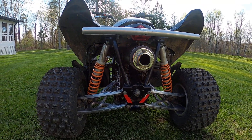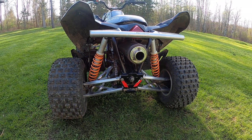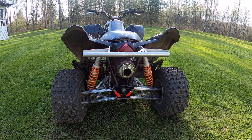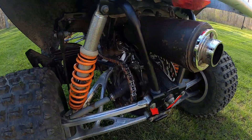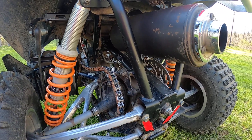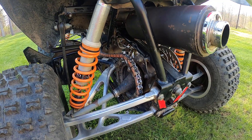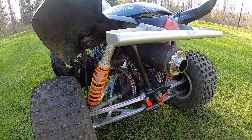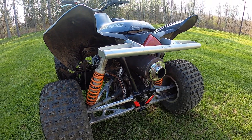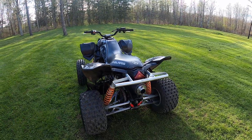I really haven't had any problems with this setup. It actually does really well on the trails and gives you quite a bit of extra ground clearance in comparison to a lot of the straight axle sport quads. One thing to watch out for is the bearings in this hub assembly here tend to go bad. They actually wear out grooves possibly in the hub assembly and the whole back end will kind of make a clicking noise. That's the case with this one but I've just been running like that with no problems whatsoever. I definitely love the independent rear suspension — the thing rides super smooth on the trails, almost as good as my Sportsman.